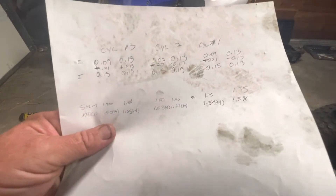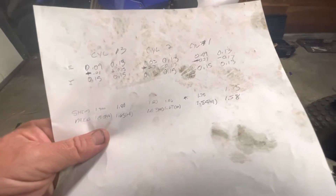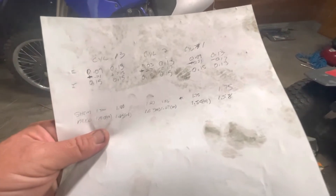So I pulled them out and these are the shims that I had in there. They're all relatively close — I've got two of them at 1.80mm, the biggest one at 1.86mm, and most of them are between 1.70 and 1.75mm. Down here are the ones that I need. Looks like I can switch out shim one on cylinder one, move it over to cylinder two.